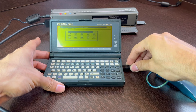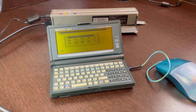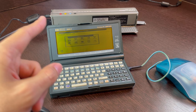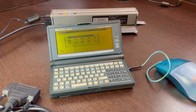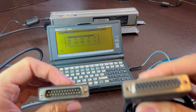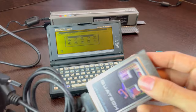The other day I was searching eBay and I found something that I thought might work to get both the printer and the mouse working together. Here's what I found: it's a PCMCIA card — a PCMCIA to parallel port card. This printer also prints via parallel port, so it all fits. The card comes with a serial cable and a parallel cable. Right now this is the parallel cable coming from the printer, and I thought maybe I could just connect the printer to this and get it working with the 200LX — and the answer is yes.